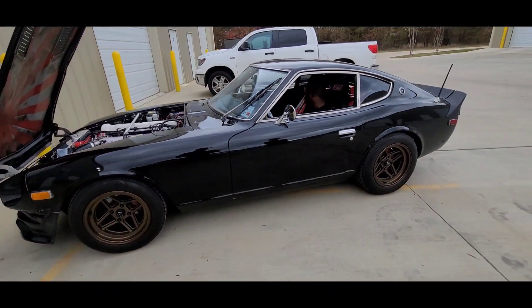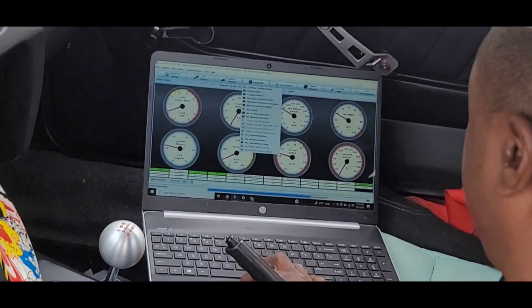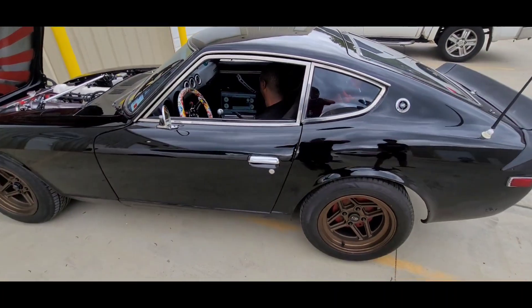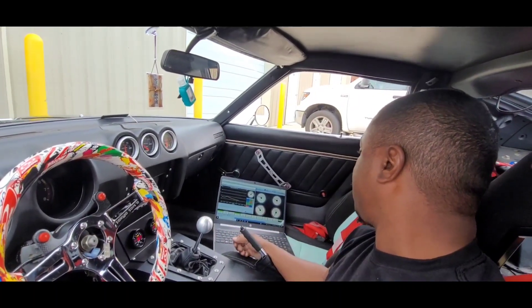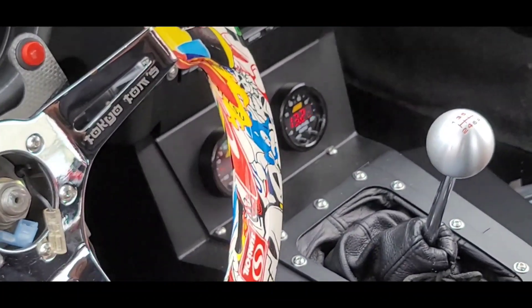MegaSquirt tune — doing a little warmup enrichment, get it just right. The only thing we're not going to be able to do for warmup enrichment is the really cold starts, because it's like 65 to 70 degrees right now. So all we can really do is throw in some values for whenever it's colder and see how it does. It should be one table to change — really simple. Warmup's engaged and after it starts off, it's completely acceptable for warming up and it'll get up to 14.5 AFR by the time it gets fully warm.